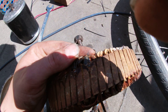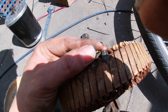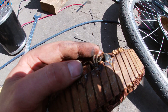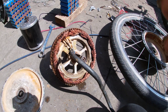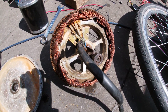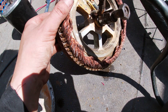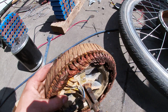I better order a set of bearings — they look like they're hanging on for dear life. It is a sensorless-capable controller though, so it won't leave me stranded in the middle of nowhere. If you've got a non-sensorless-capable controller and the sensors look like that, I'd definitely say replace them immediately — otherwise you'll end up buying duds.